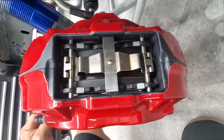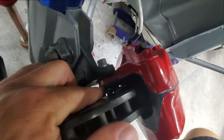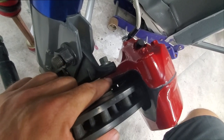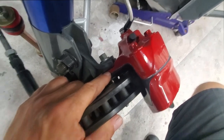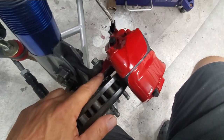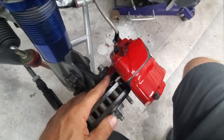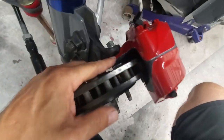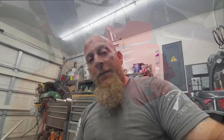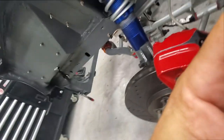Three millimeters landed me right in the middle of the rotor and it worked out really nice. You want these surfaces flat, and to grind them by hand — even though it's only three millimeters, it's a lot to grind evenly and flat, it's near impossible. I took it to my local machine shop, bought the guys coffee, and they put it on a Bridgeport and shaved them down. If you change your brake lines to stainless steel, routing those brake lines is very important.